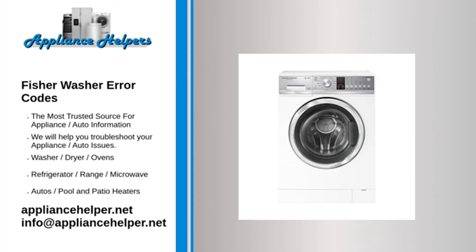Codes 37, 114, 245, 247, 248, 249, 250, or 253 indicate water is not draining. Fix: Remove any clogs from the house drain for the washer. Remove any clogs or kinks from the washer drain hose. Unplug the washer and check the drain pump for a clog. If the drain pump is defective, replace it.